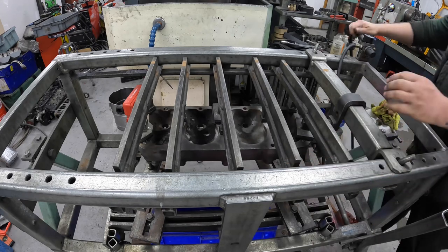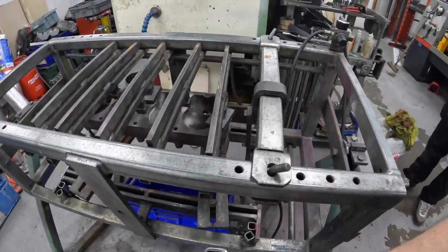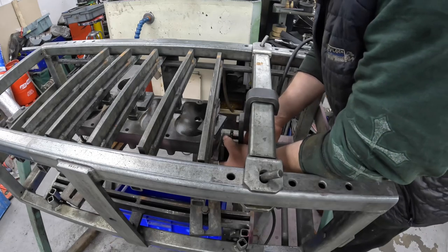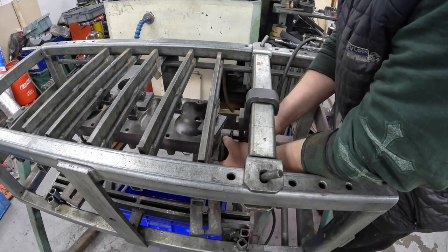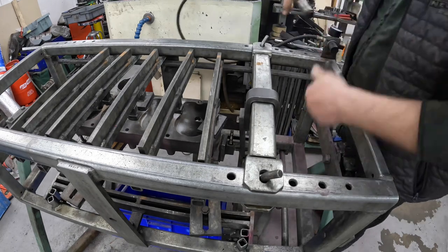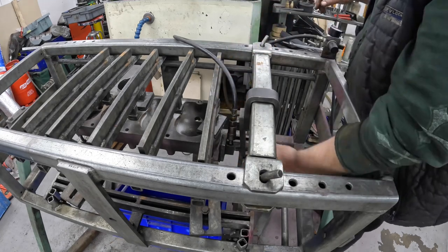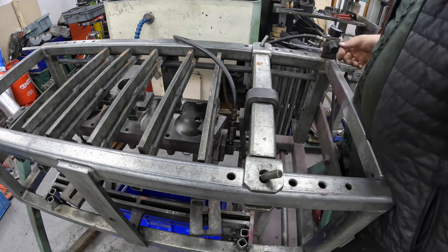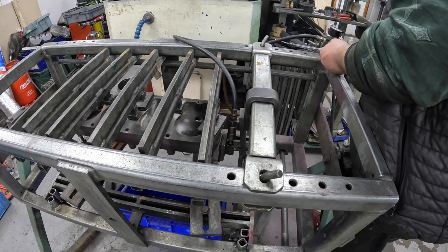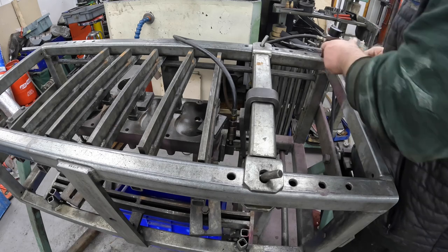And then put some air into the cylinder head, which we're gonna do by putting a fitting on this part down here. I don't know if the camera's picking it up, but so we connect the air to the cylinder head now. Now this is a low pressure water system, so we don't need to get it up to 30 psi. Around 10 is more than enough on this. And then what this will show is where I've stitched it, if there's any little leaks.